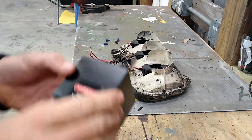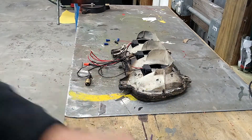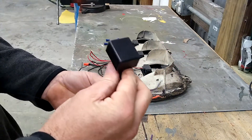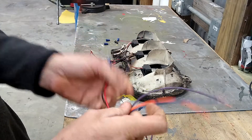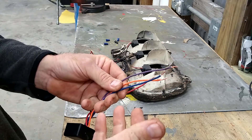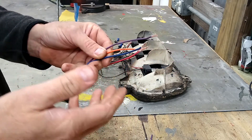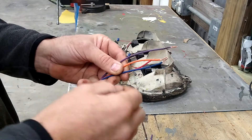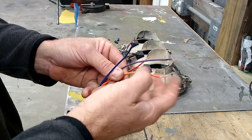The kit I picked up is right here. The reason mine was a little tricky is here's the little relay box — everything has five wires in it. Obviously you have your hot, your ground, and three other wires. What was tricky was mine didn't have any wiring instructions, so I didn't know what each one went to, and since my lights go from the inside out I didn't know what was first, second, and third. After playing with it I found out this particular one is set up where blue is first, then orange, then purple.